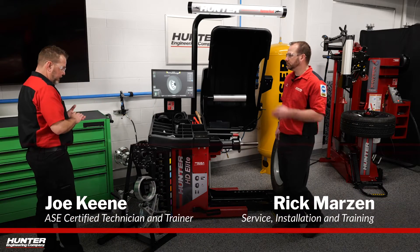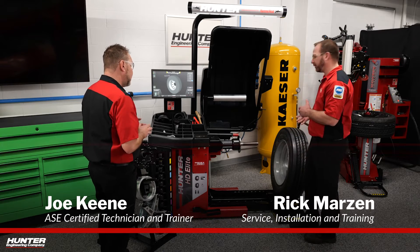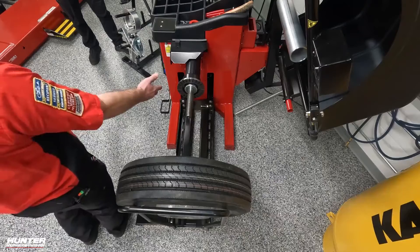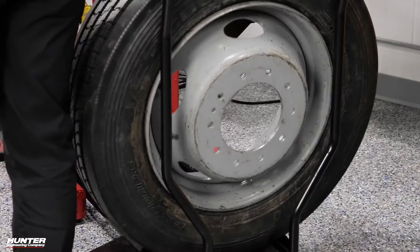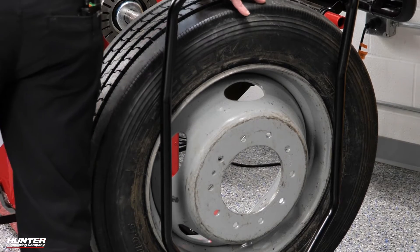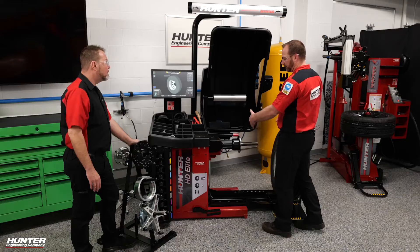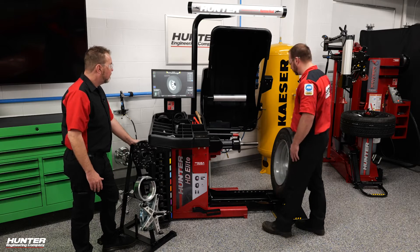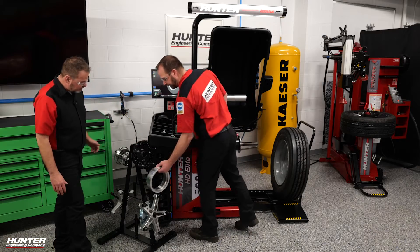What's going to make this one unique is we're going to have to build this one out. We have a kind of a crazy hub mounting on this wheel — it's sticking super far out. It looks like a dually wheel, but it's not. It's a standard wheel on an F550 or things like that. So we're going to have to build out that spindle because if we put that on even a regular balancer, we're not going to be able to measure the profile of the wheel correctly — it's going to be too close to the camera. So we're going to use our medium-duty collet set and this spacer to help build that out.